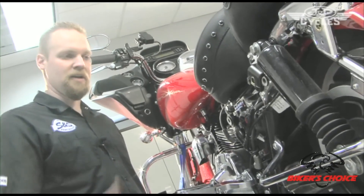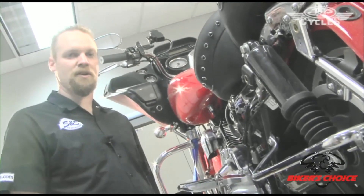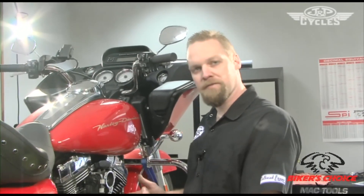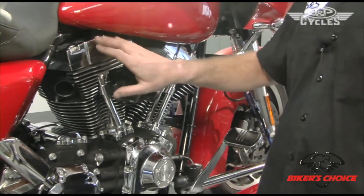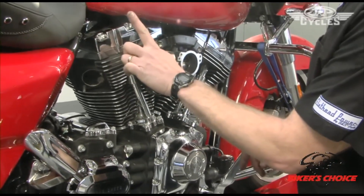We'll go back to the other side of the bike and get ready to remove the push rods. In this procedure we're going to show you how to remove the push rods. The reason why you'd use a bolt cutter versus pulling the top end off is it's a lot more labor to remove all these rocker boxes so that you can actually move the push rod up.